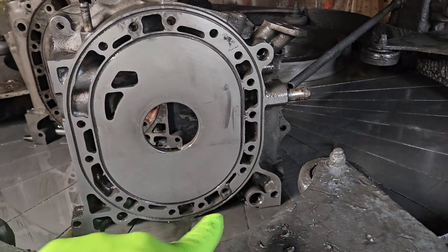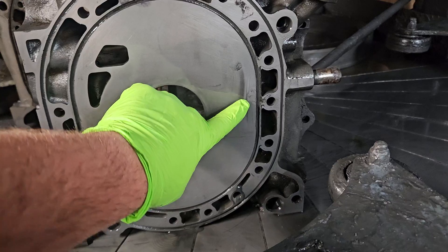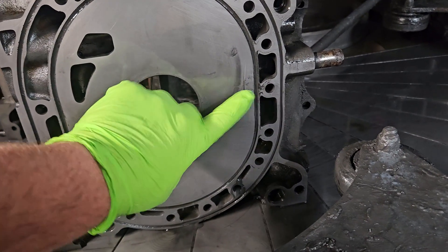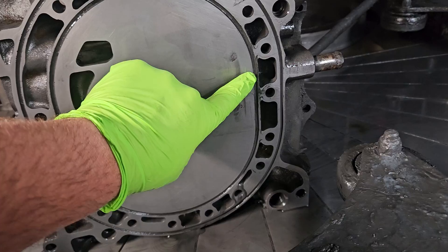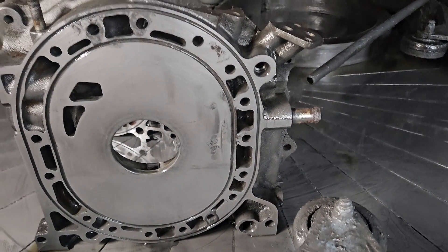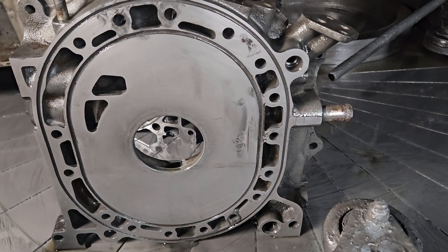You can see it's a little dirty, but the rest of this housing is shaping up really well. We still have a little bit of wear left. We're going to continue to remove that, and I imagine about when this wear is gone, we're also going to flatten out this warpage, which is most likely the reason this motor failed and then failed again.